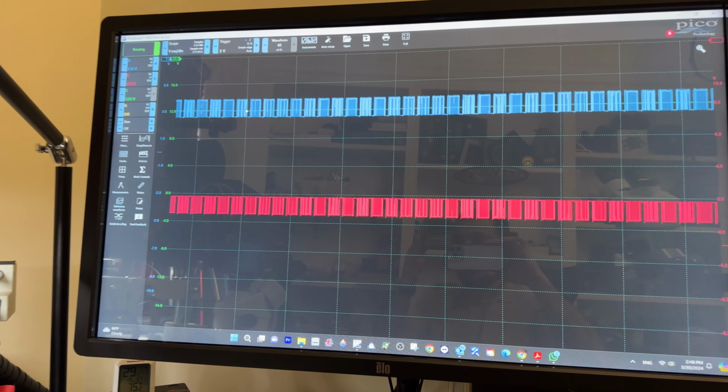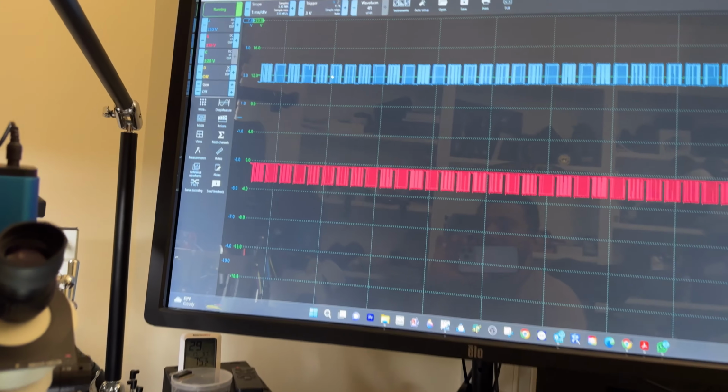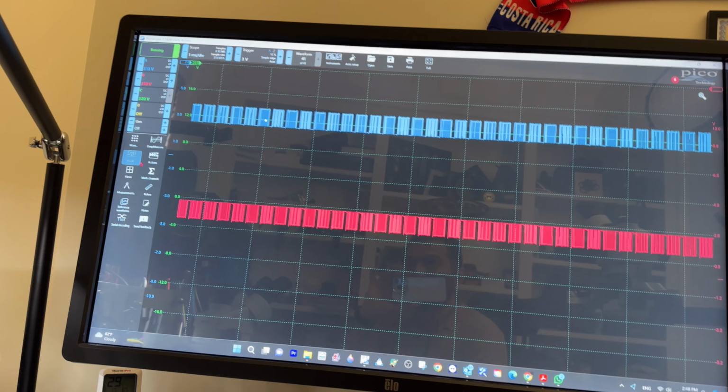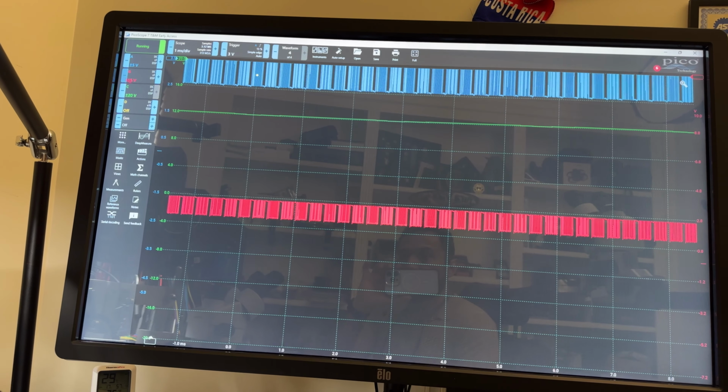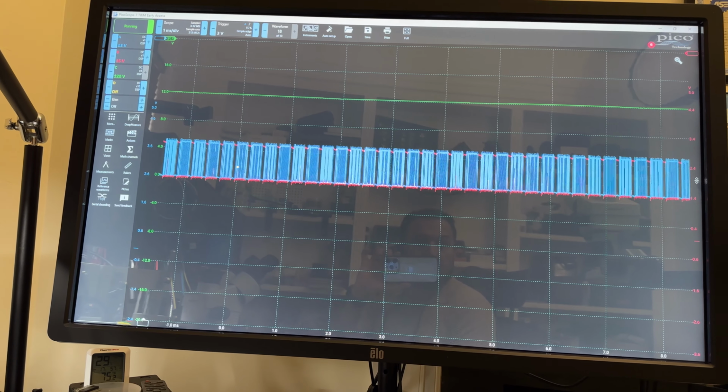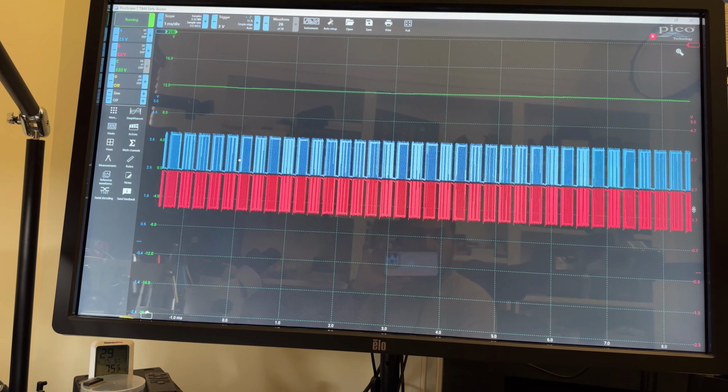And this CAN bus is PCM. So we immediately know that this computer is now healthy and talking. I can reduce the voltage in here to 5 volts because it's CAN bus, right? So, and we can bring this kind of high, kind of low down.